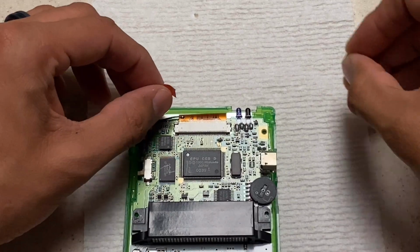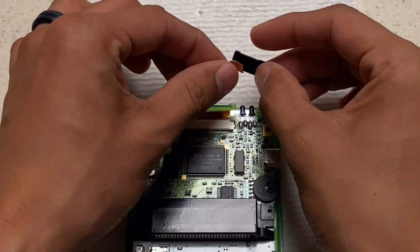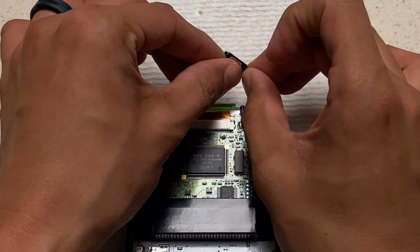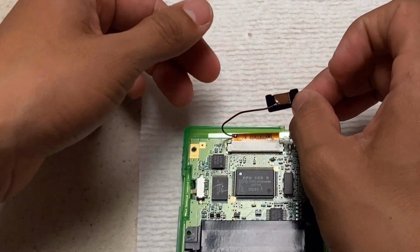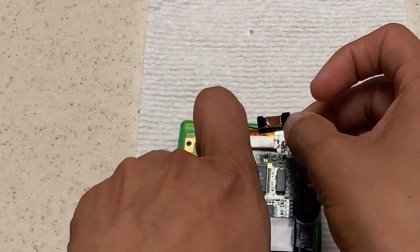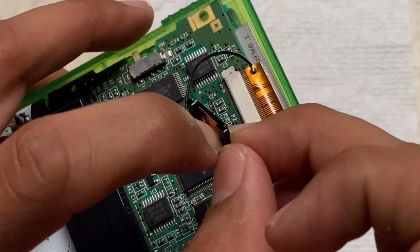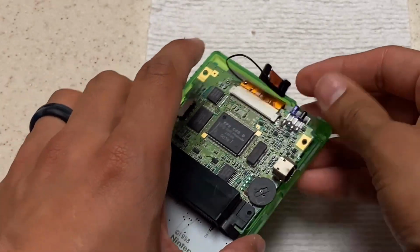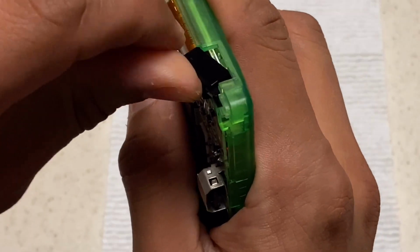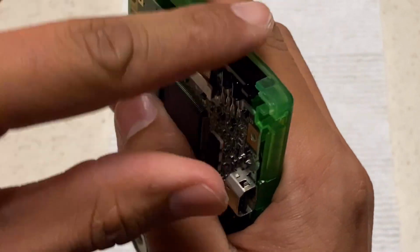Now for this adhesive part, do not stick it all completely on the inside of this IR window. Raise it slightly and fold the little top edge of that adhesive over the side of that IR sensor. Basically, you want it to stick up so that way it can still touch your finger whenever you tap the IR sensor. Here it's not done yet, but I'm going to show you at the end of the video. But if you understand what I'm talking about, then go ahead and do it and then just continue on with this tutorial.